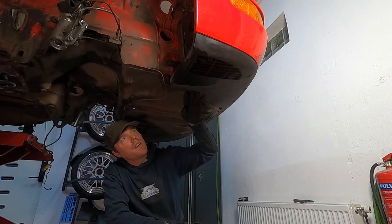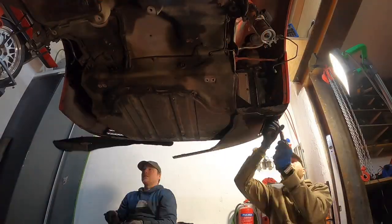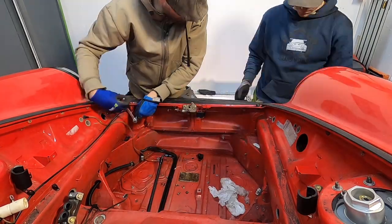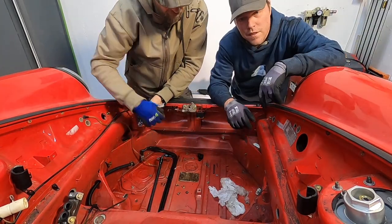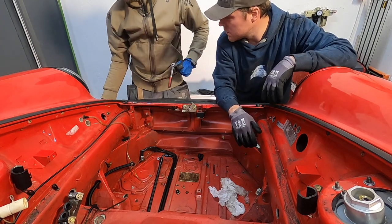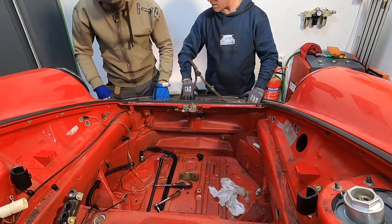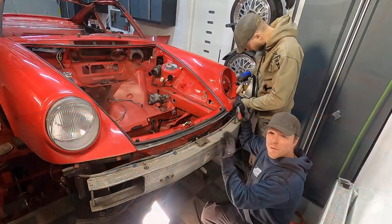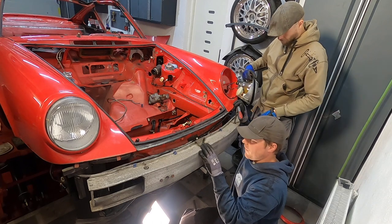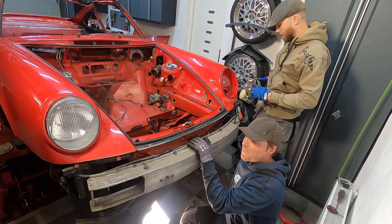We're going to start in the front. There's an inner cover here that we're going to drop first. After that is out, time to drop the bumper. The only thing holding the bumper now is these bolts on the inside where we attach the ones covering the sides. With the bumper off, we get access to the impact beam here — an aluminum beam that is supposed to absorb energy as you hit someone. This needs to go off as well, and I'm going to reuse it as a safety measure.